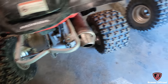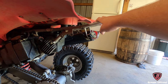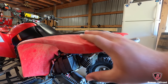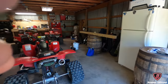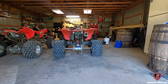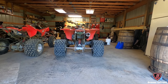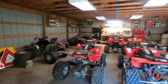Four-wheelers get ridden hard. That is not the normal shape of this — it's been banged off a tree. My subframe you can see curves up from wheelies catching the grass and ground, and it's slowly bent it up. Little stuff like that is important but it shouldn't be a make-or-break for buying a machine. You should step back from the quad, get down low, and check to make sure the frame isn't slanted. My subframe is tweaked a little bit to the left — this fender is lower than the other from the plastics being bent.